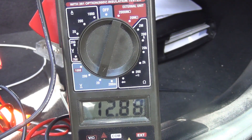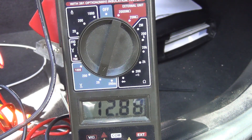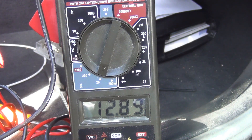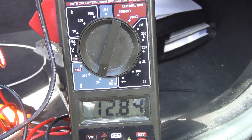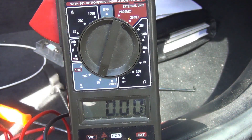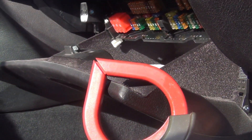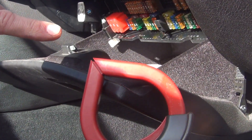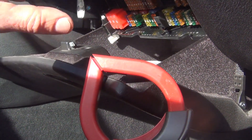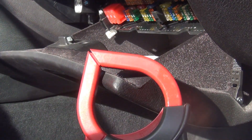I got 12.8 — excellent. And I'm going to check the other side of that fuse as well and I should see 12.8. That means I have good power and that fuse is good. If I saw zero here checking from one end to ground, I'd check the other side — you might have power on one side but not on the other. The reason for that would be that the fuse is open: you'd have power coming from the feed side trying to go through the fuse but it's open, and you'd have no power going to the component.